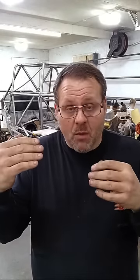I was just looking at it like, how do I do this fuel cell itself to put it as close as I can, to have it as tight and as compact and have the safety around it, and then turn around and have that outside structure that's quickly replaceable and that is going to absorb energy before it ever comes in contact with a fuel cell. And then potentially, what I want it to do is I want that whole rear clip to push down. I didn't go into all that on the video, but the angles on the fuel cell and stuff, what's going to happen is even when it contacts it, it's going to drive it under it. So the two are literally going to walk past each other, and so it's still not going to necessarily collapse on the fuel cell. So that's where that came from, just going through that process of what we were trying to achieve.